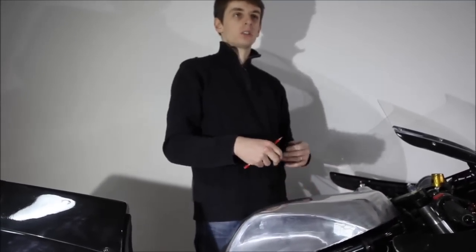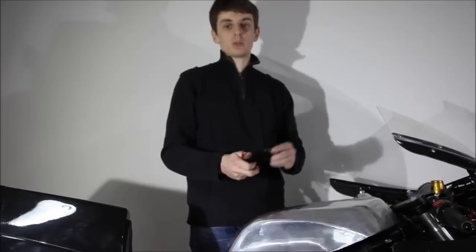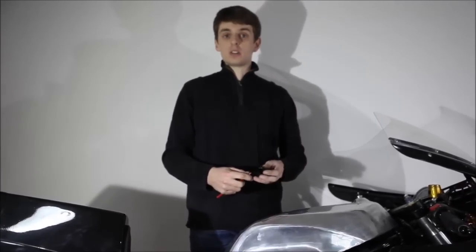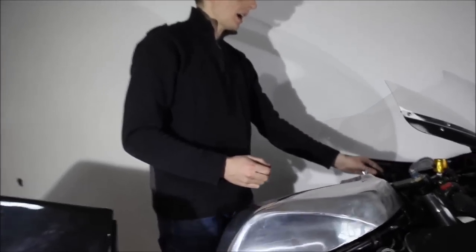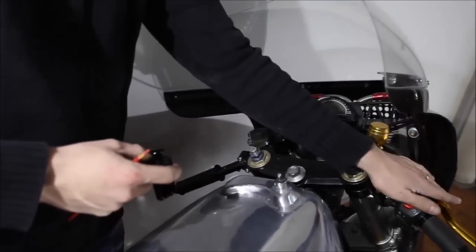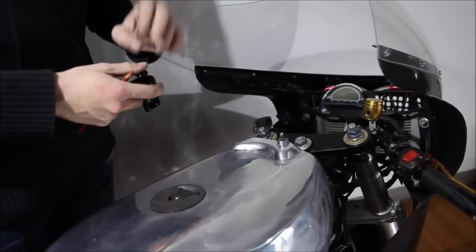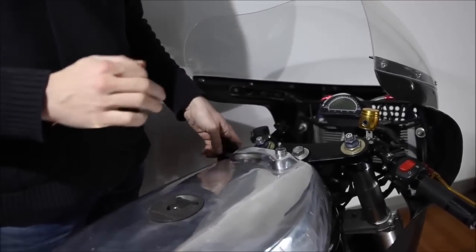So when you get the exhaust set, install it first and then consider what's a comfortable, good spot for you, where you have enough space to mount the hand control and make sure it doesn't interfere with any other parts. Take a minute, decide on a place and mount it safely. Especially, depending on where you mount it, make sure that it doesn't interfere with your clutch cable, brake, or with the movement of your steering. It all needs to be separated. Make sure it doesn't hit anything, otherwise it might get dangerous for you.